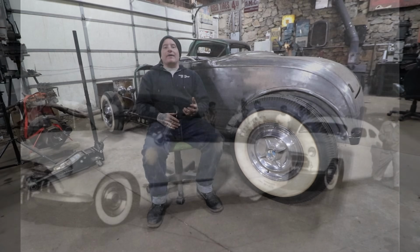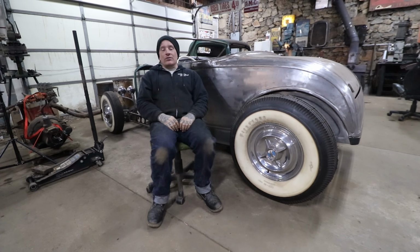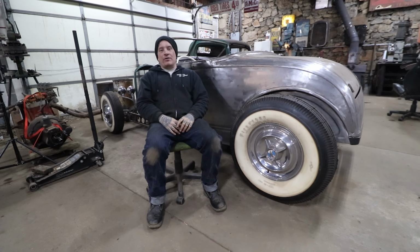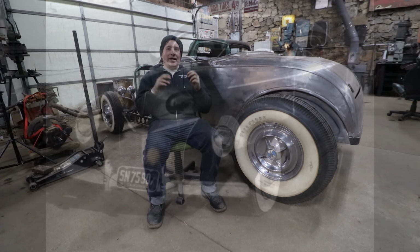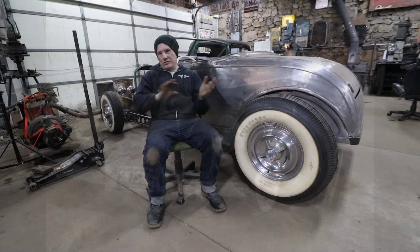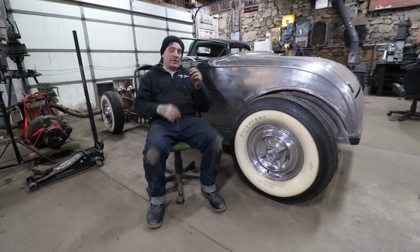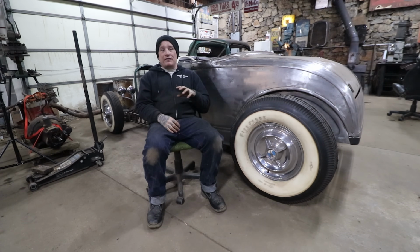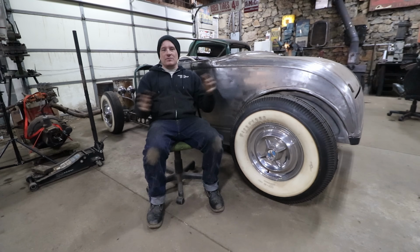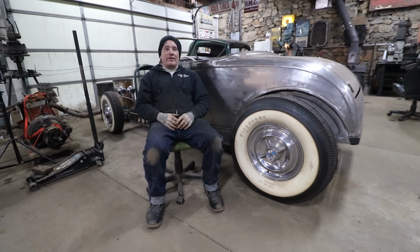Now the thing with some of the Cadillac hubcaps that are lumped into that sombrero style, for different years they used those caps and they're called sombrero style. Those caps usually had a kind of specific to Cadillac type wheel mounting clips, and a lot of times they don't just clip right on with no effort. Sometimes you have to change the trim rings on the inside of them to make them fit your wheel. So do realize that you may have to modify the caps to get them to fit your wheel, but they give a great iconic look, and you will see that on a lot of the bigger style customs. They were running sombrero caps or early 50s and mid 50s Cadillac hubcaps.